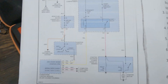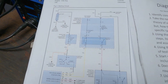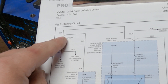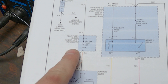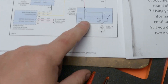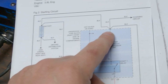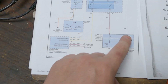Over here to the diagram. Looking at the diagram, we have the battery and we have two leads that come off the battery. One goes to the ignition switch fuse, which is a 15 amp fuse in the rear block under the seat. The other lead comes over to the under hood fuse block, goes through the start circuit breaker, through the relay switch side, and then down to the starter solenoid — that is our signal to make that starter work. The other lead off the distribution box is the B-plus to the starter, which carries the majority of the amperage.